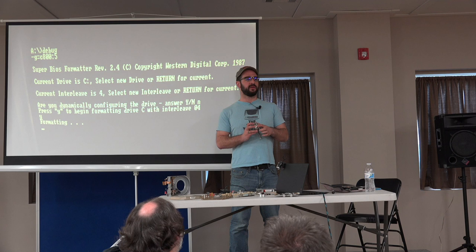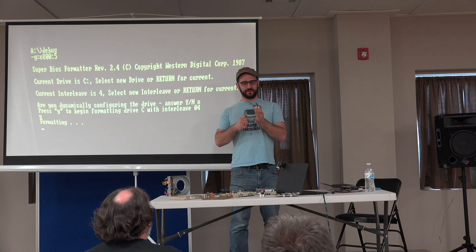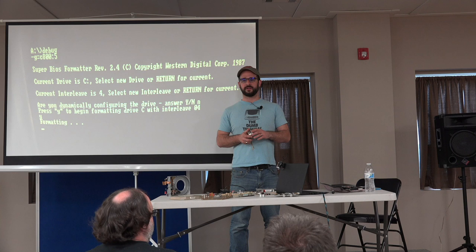And obviously, I like to say that the term minor surgery is an oxymoron, like personal surgery. Same thing on a hard drive. Anytime you take it apart, that could be it. So you don't want to use crappy lubricant on a drive and be like, great, it works, that's good enough, and then in 5 or 10 years, oops, I need to do it again. Oops, now it's broken. So, yeah, use a synthetic lubricant.